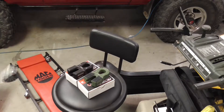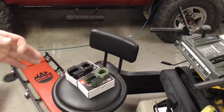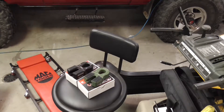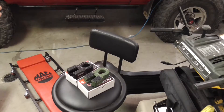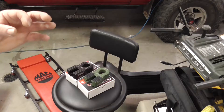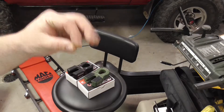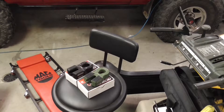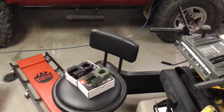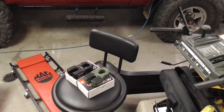The winch line originally had a cheap metal insert — basically just to insert into the loop — and then a hook put on. But the first time I took it out, unspooled it, and had my wife put a little bit of pressure on it around a tree and winched it in, that metal basically crushed down. It's only a chunk of metal that goes around inside the loop. Ever since then I just run D-rings in that loop, and I've been seeing it wear a little bit even though I don't winch all that often. I noticed there's some wear in the winch line.